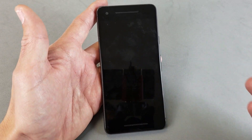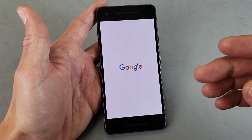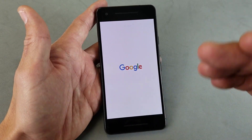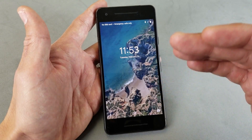Now, why do you want to put your phone in safe mode? Well, it's very simple. If you're having issues — maybe something to do with your camera, or something keeps freezing, or any other issues with your phone — what you may want to do is put your phone in safe mode. What that does is disable all third-party applications and load the minimum drivers.